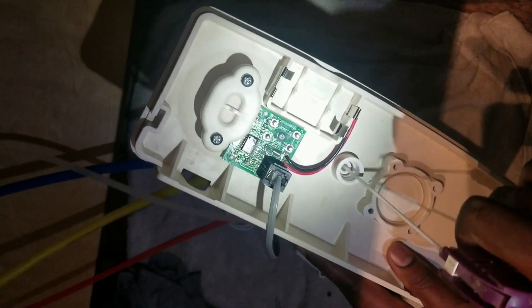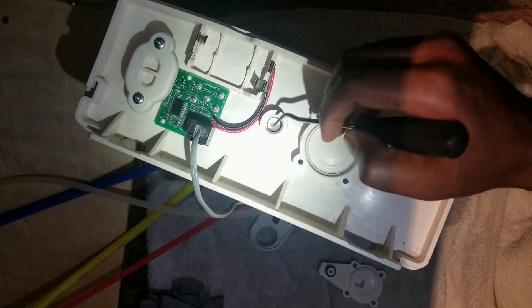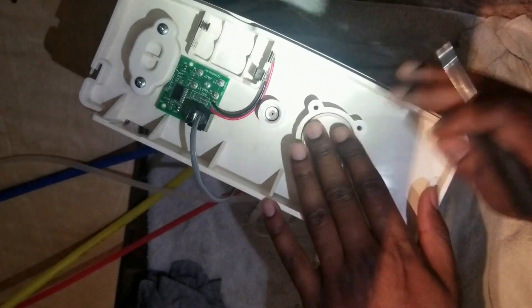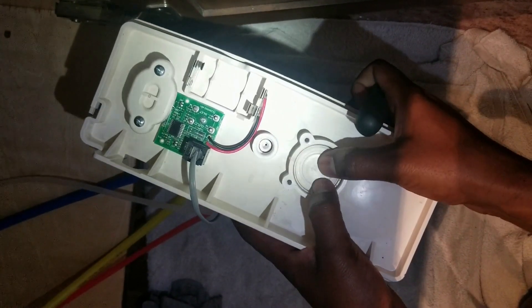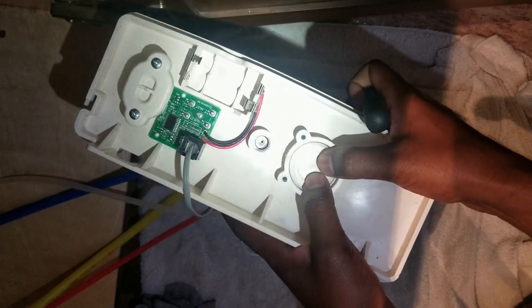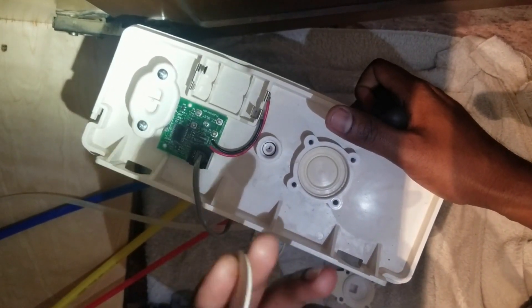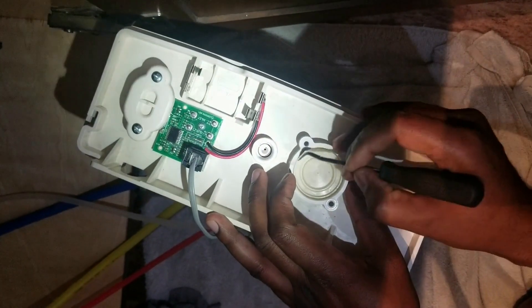Make sure nothing is stuck in that little tiny hole — I'm just going to blow a little air in there. That part looks good; I don't see any dirt particles in there. For the automatic shutoff, I only took it out recently so it's coming out pretty simply. You might have to squeeze the diaphragm a little to get it out — don't use any sharp tool, use your hand or fingers. This diaphragm looks good; it's made of neoprene material and is not worn out.